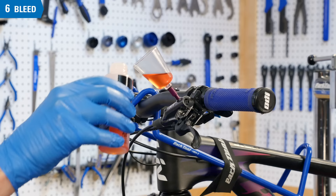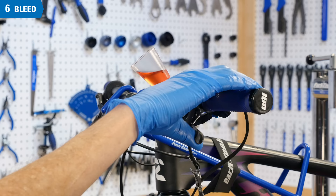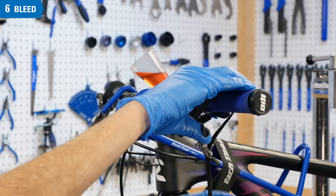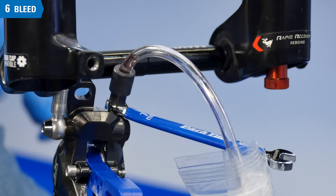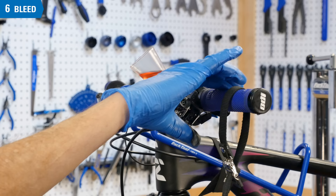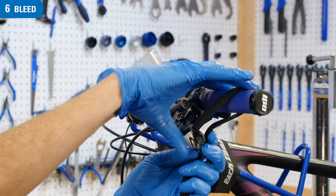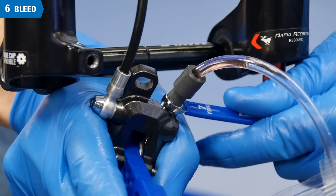Note: you may not see bubbles during this part of the bleed. Leave the funnel and bleed hose in place. If necessary, refill the bleed funnel to about half full. Pull the lever to maintain pressure on the pistons and hold the lever to the handlebars with a strap or zip tie, or have someone hold it for you. Now quickly open and close the caliper bleed nipple once — pressure will be lost at the lever as the fluid is forced out the nipple. Release the strap and repump the lever until it again feels firm. Retighten the strap. Repeat the quick opening and closing of the caliper bleed nipple.